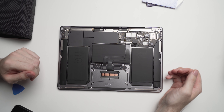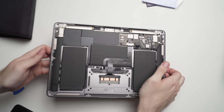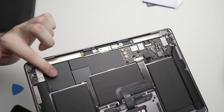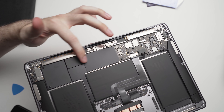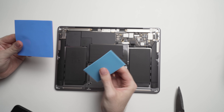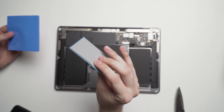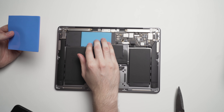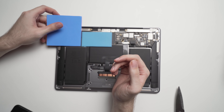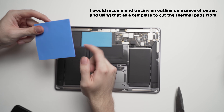This is what we're actually going to be applying the thermal pads to. This particular part is a little bit higher than this part, which is actually recessed, and this is what we're going to be using the different size thermal pads for. The next step is to cut down the thermal pads to size — they generally come as a 10 centimeter by 10 centimeter or 10 centimeter by 5 centimeter strip. The 1.5 millimeter one is already pretty much a perfect size, I might just trim it on the edges a bit. The 3 millimeter version will need to be trimmed down quite a bit. It doesn't need to be exact — just take a rough measurement, maybe mark it with a pen, and cut.